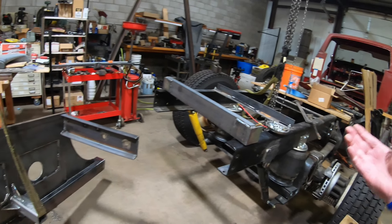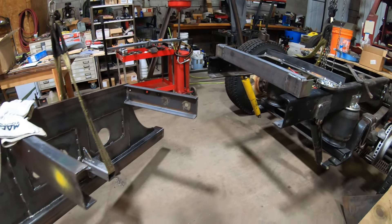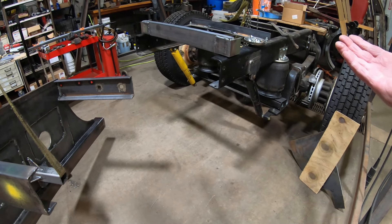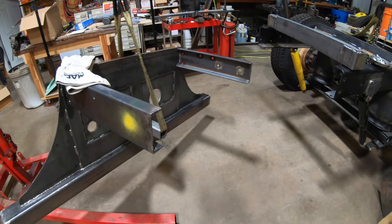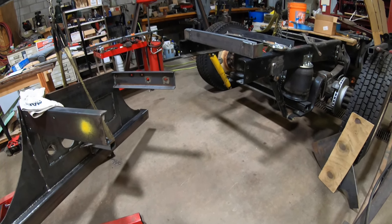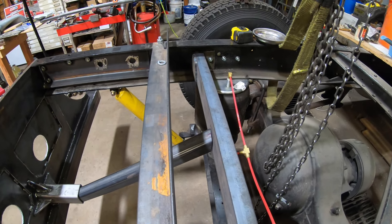Because of the size of the bumper — the two flanges on the top and bottom — you wouldn't be able to rock it out. The pieces of angle iron that stick out on the ends would interfere. So I've got to put this back in, test-fit the tube back up to the end, tack it with the welder, get the bolts through the end plates, mark where the holes have to be, then pull it back apart. I'll probably take it to the welding table to weld the whole thing out, then bring it back, fit it on, and paint it with POR-15.